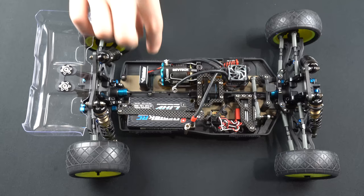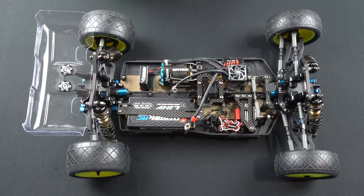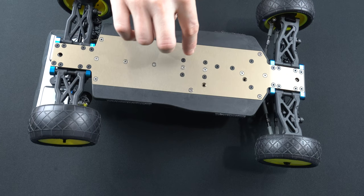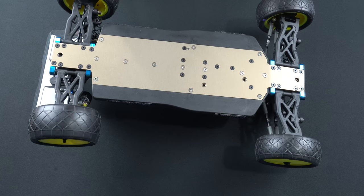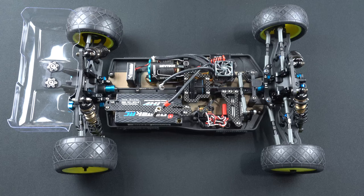One other thing I noticed during install: I didn't buy enough screws to cover the braces, so I need to pick up a few more. There are still a handful of steel screws on the car I'd like to replace. Screws fitted against arms and drivetrain parts like motor mounts will remain steel; the ones going into plastic all got replaced with titanium. I also want to correct something from the beginning of the video — I weighed the car without a body, so let's weigh it the same way again, then add the body to see how close we are to the magic number.